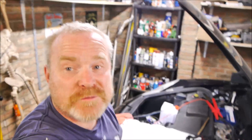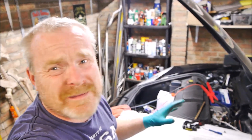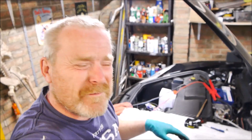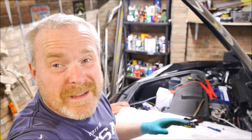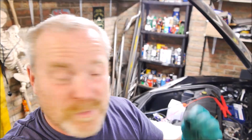You do not get this level of MacGyver-y in a Porsche garage. If you'd gone to a Porsche garage, the strut tops are 140 pounds each - and once they've done one they'd say why not do both, then mention the shock absorber looks rusty and suggest replacing those too. It would have been into 1,500 quid. This is costing me nothing. You can't actually buy these studs, and really I should have a splined one to go back in, but I'm going to put a bolt through instead - I can get underneath, put a bolt on the other side, put a nut on the top, and I'm back to three bolts on my strut.